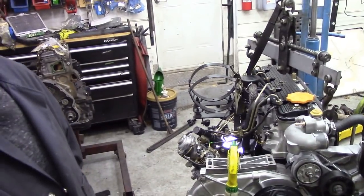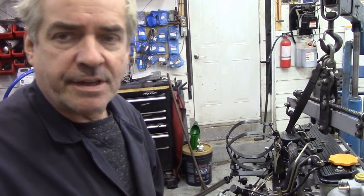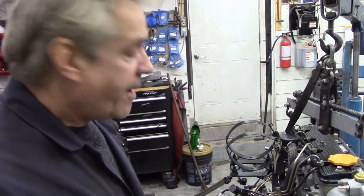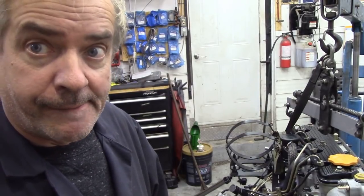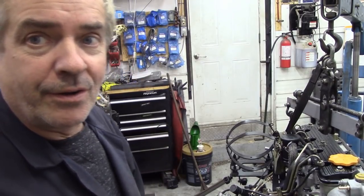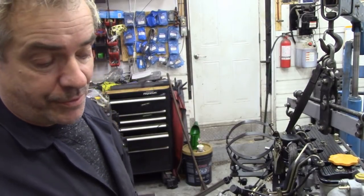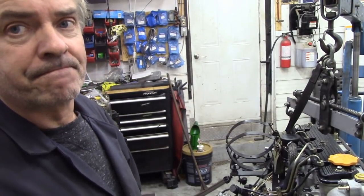As you probably know, everything I try to build up I test with the smoke machine down here. And I've almost finished this engine now. I've got the turbo and intake to put on, but that's not really much. However, as you can probably hear in the background, the smoke machine is bubbling away, but I can't see any smoke. Now, just before lunch, I looked and looked and looked all over this engine to see where it was leaking from. I couldn't find anything. Couldn't see any smoke, but the machine is bubbling away. So where's it coming from?